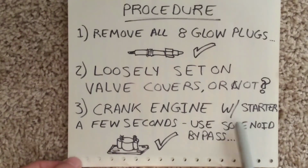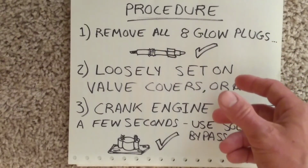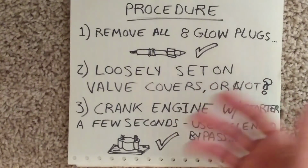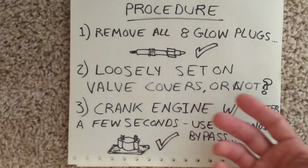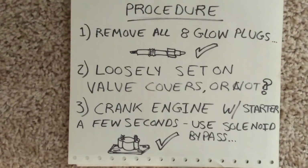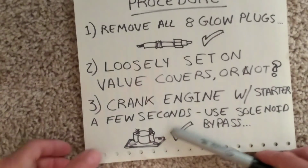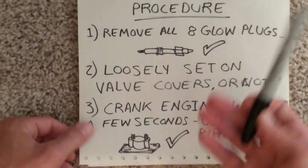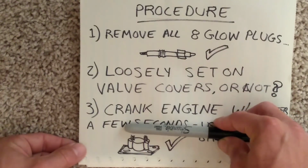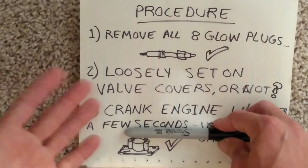Now, if you try to crank over the engine with the key, it's going to try to actually fire the injectors, but they may not necessarily have fuel or oil on them, so you really don't want to do that when you're not ready to start the truck. So the way you get around that is you connect your batteries and you actually bypass the starter solenoid with a screwdriver. This is also a neat trick. If your starter solenoid goes out, you can get a screwdriver and put it over the two leads and basically close the circuit to bypass it and crank over your engine.